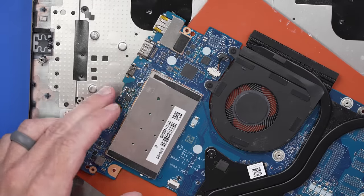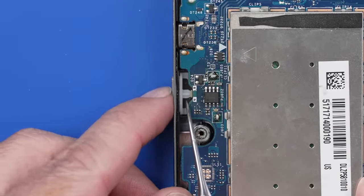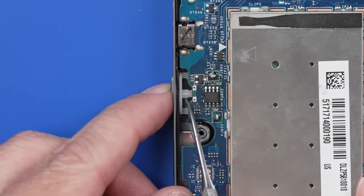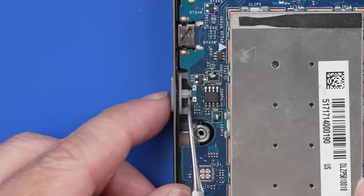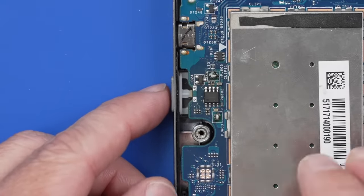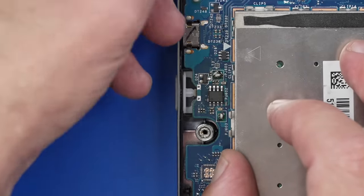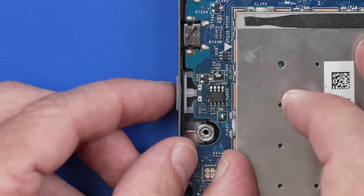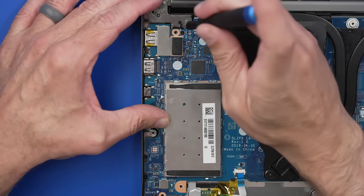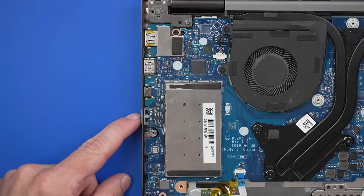The next problem is getting this thing to fit correctly. With the board installed, it actually fits in there much better than the other one, but the problem is the button doesn't bounce back all the way — it'll press the button but never releases it fully. I might have to shave this off a little bit, though I don't want to do that in case the correct button becomes available. I wonder if we could somehow shift the motherboard over just a little bit — oh, that works! If I screw the motherboard down with some pressure on it this way, maybe that would be enough to make this button work. Let's put some pressure on the board that way, then put this screw in. Let's check the button — oh yeah, that works great!